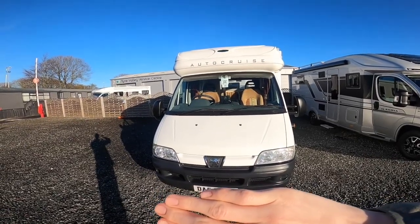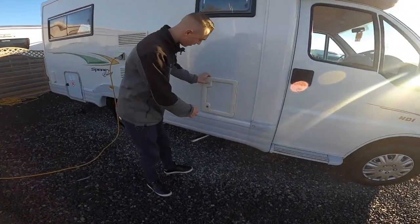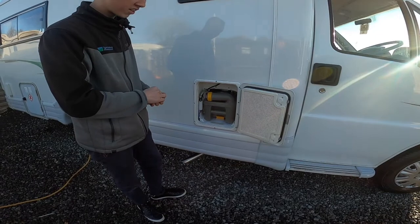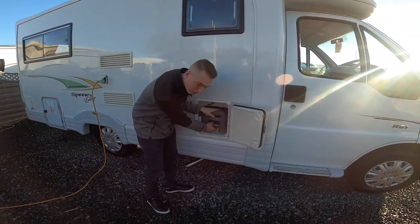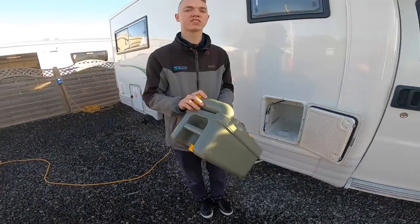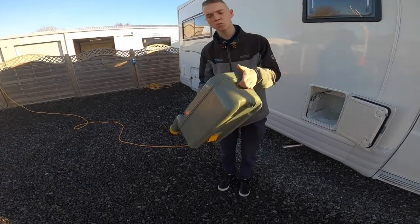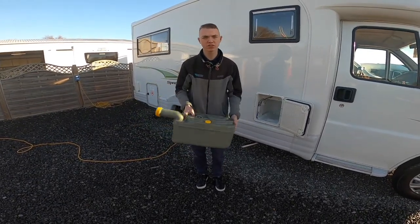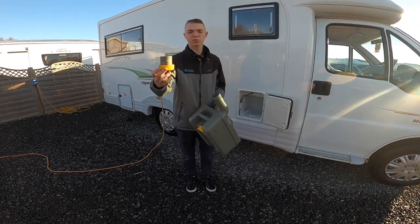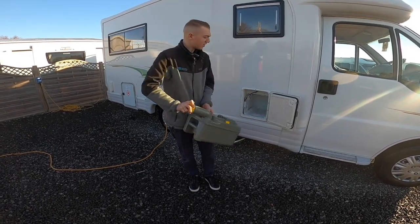Starting my walk around on the driver's side of the vehicle. First you've got your cassette here. Using the habitation key — the black round one — opens this lock to take the cassette out. There's a small yellow clip; make sure the blades close on the inside of the toilet. Lift and slide out, carry it to your waste disposal point, remove the cap, press the button and tip it out. Once tipped, rinse with water and tip out again. To fill with chemical, it's 120ml which is four ounces of the blue or green chemical.